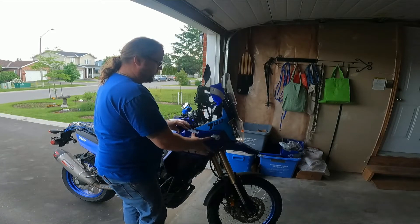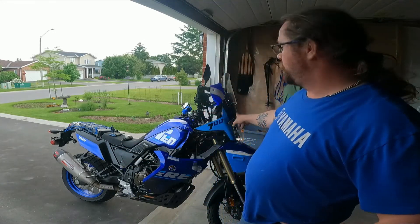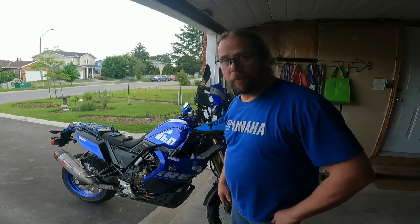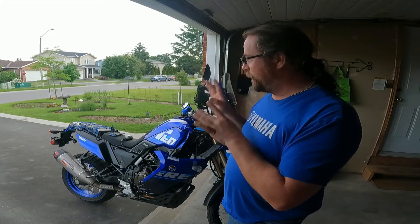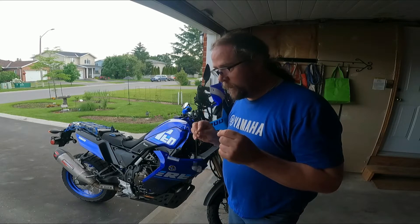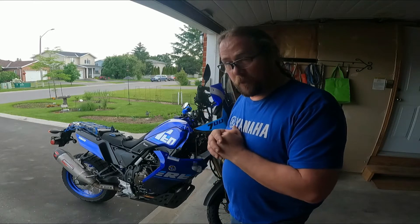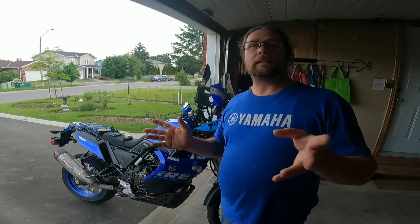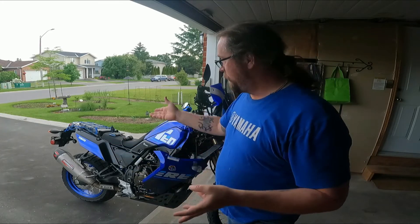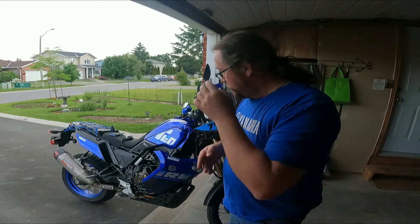What I may have to do then is go out and get a flasher relay, I guess. Anyway, we're going to continue on the other side, swap them out, and swap out the back ones as well. The back ones require a lot more to take apart — you have to take apart the whole body panels and all that stuff. If I find there is a hyper flash with them, maybe the bulb wattage is different because it's not an LED — it's just a regular tungsten bulb. Maybe the resistance of that bulb is different. If that's the case, no big deal. I do have flasher relays at home — that's just a simple plug-in-place swap. That would add some more resistance to the flasher loading unit, which would then slow down the flash again.